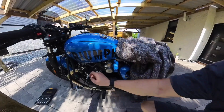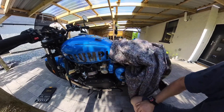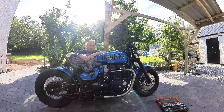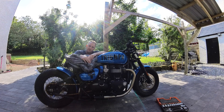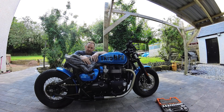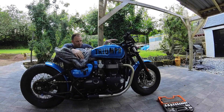I've connected up all the extensions to the wiring loom, and I've got the tank back on because for this next step I want to run the bike and actually see that everything functions properly. If you know that the parts you bought are genuine and correct, you probably won't need to do this step. But as I bought these from somebody on marketplace, I don't know if the part numbers are correct for this bike, and there could be a defect in one of the extensions or plugs. So I just want to check everything works before I go disassembling the actual bar arrangement. Here's the moment of truth.